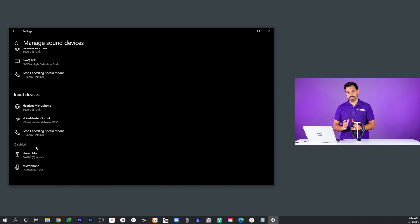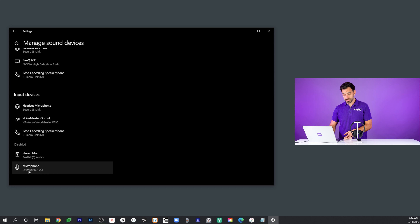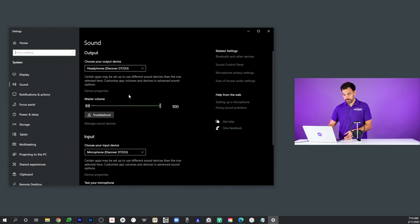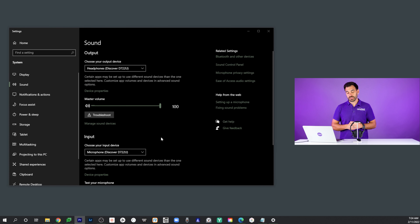Now, if you have a wireless headset, you're going to want to do a couple of things. One is turn the headset off. And if it has the included Bluetooth USB adapter, you're going to want to unplug that from the computer. And if it has a removable battery, you're going to remove the battery from the headset at the same time. Once you've done all of that, let it sit for about five to ten seconds to fully power down. Then plug the battery back into the headset, turn the headset back on, and plug in that USB adapter if you have it. Now, if you're using a wireless headset just connecting to Bluetooth on the computer, you're going to want to un-pair the headset from the computer and then re-pair it back so that it is reconnected.